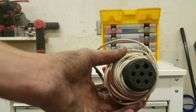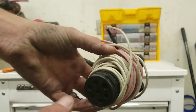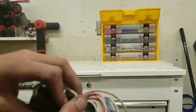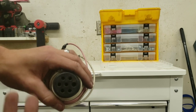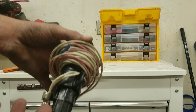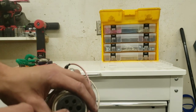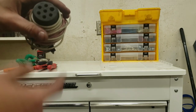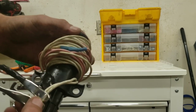This here is a 7-way — the round-pin one. It has the hot and ground that go inside. You hook this up to the batteries on the service truck, plug it into your trailer, and it'll light all your lights up so you can make sure everything's working. These things are amazing — a lifesaver. You don't have to spend $1,800 or $2,500 on a big roll-around trailer light and air tester. This costs maybe $20 — you can build one of these. You can't check turn signals and stoplights with this one, but I have another one you plug into the back of the service truck that does test all lights including turn signals.